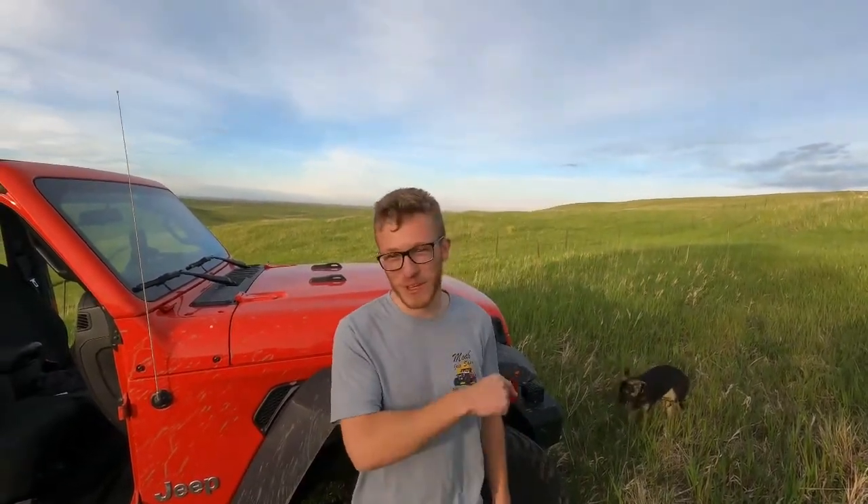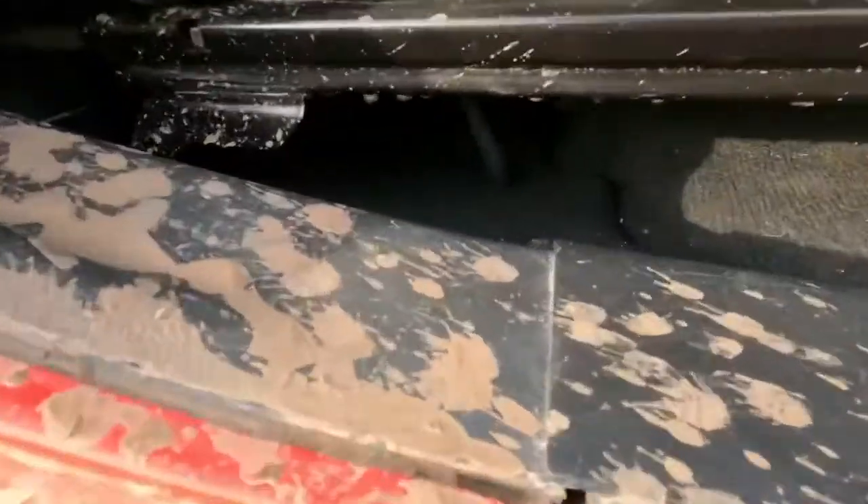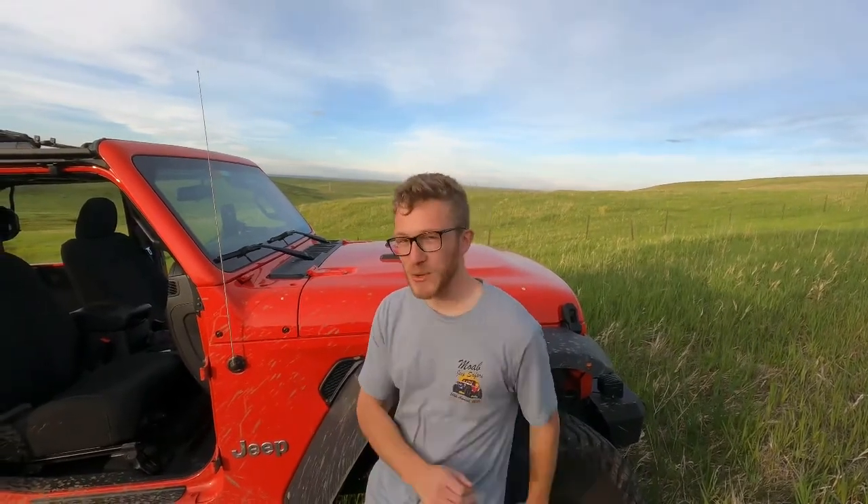I also have the ARB which I bought a long time ago from a different Jeep - we're gonna do the under-seat mount, it stays cleaner that way. The rear is already a Dana 44, so we're keeping that - it has chromolys from the incident. We're going to do an ARB locker in the rear. It's an RD245 compressor - they're a bitch to get so our twin compressors are waiting. I would have loved to do an E-locker in the back, but we'll have E-locker front and ARB rear with the twin in the middle. Also putting G2 4.88s in the back to match it all up, probably a truss on the back to make it hold together. With Dana 44s front and rear, lockers, chromoly - it should be a pretty decent package, especially when I push to 40s.